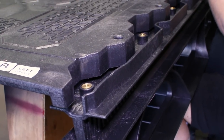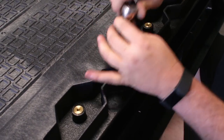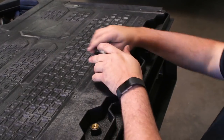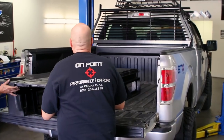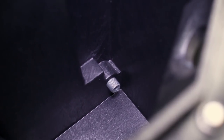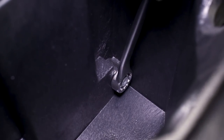Next up, we'll be bolting the driver's side deck half to the center vert. You can see how it lines up with every other bolt location and will eventually mate perfectly with the passenger side deck. Once the deck is bolted to the vert, set the driver's side deck assembly into the truck bed. The axles will be inserted into the center vert as well as the tailgate ammo can. Tighten them down enough so that the axle end is difficult to spin with a half inch wrench.